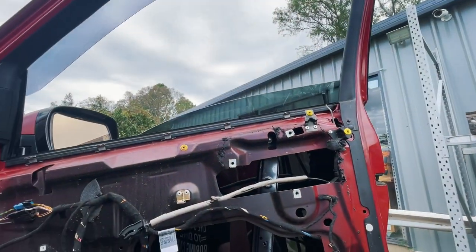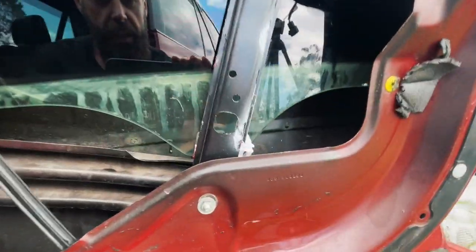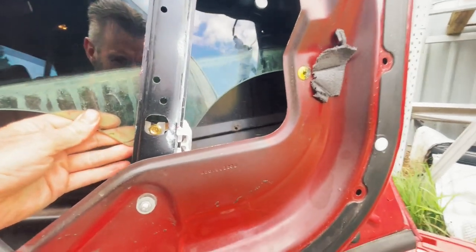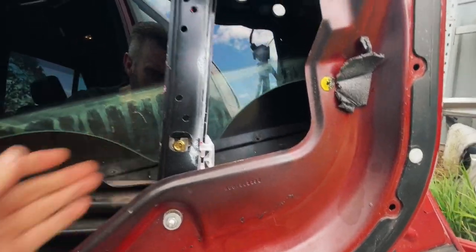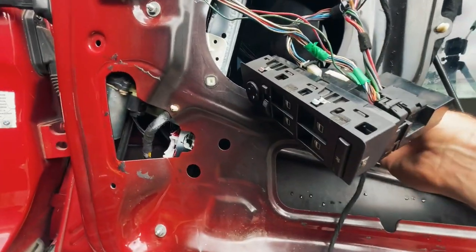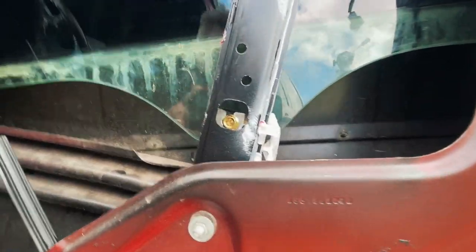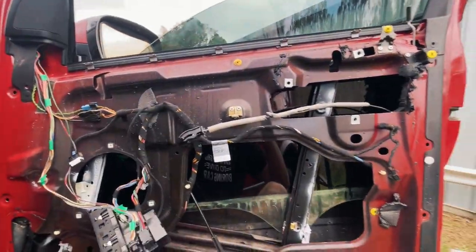I've got lithium grease on the runners and silicone spray in the actual window guides at the sides — we've fixed the creaking, so at least it's running smooth now. The window doesn't move forwards or backwards; it's seated perfectly. My bodge fix with the bolt is all working fine, window's tight, she's not going anywhere. I'll build my little homemade vapor barrier and then she'll be ready to go back together.